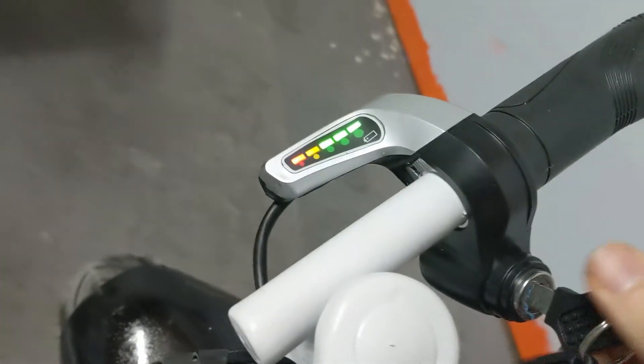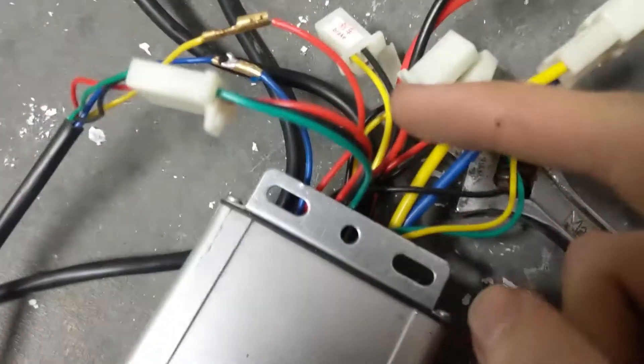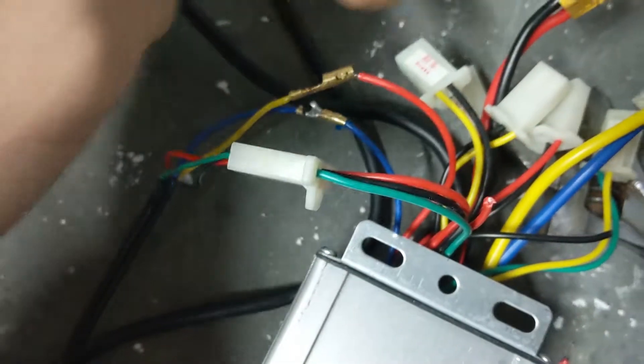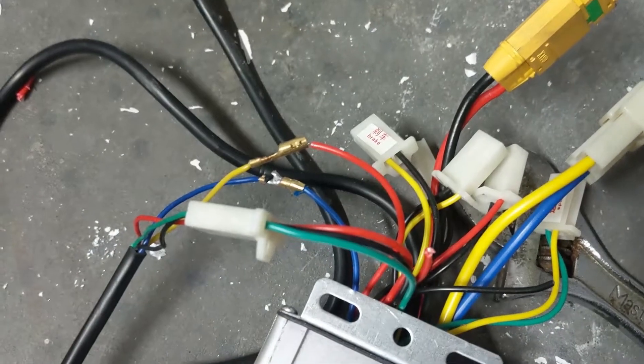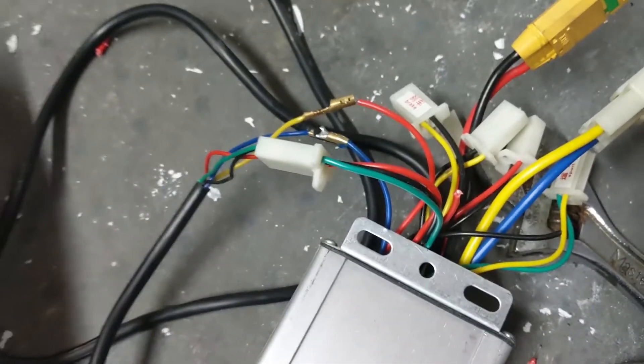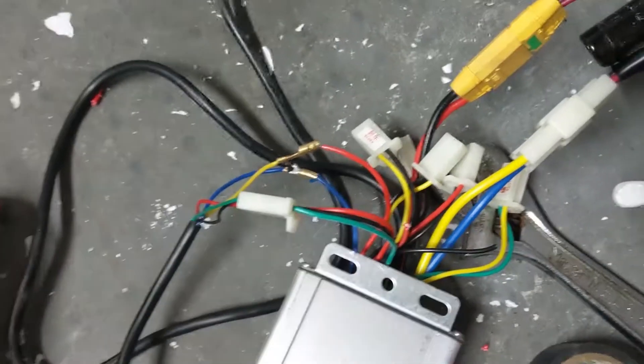I turn the key and that is full throttle. Here's my battery setup - it's three separate batteries so I can charge it on a balance charger instead, because a BMS costs money and that allows higher amperage. The wiring method it suggested, where the red wire connected up to the yellow, would not work unless I took the red wire and touched it to blue - it would disable the lock and the lock did not work at all. I'm glad I did it my way even though I switched polarity at first. At least nothing got fried and everything's working.